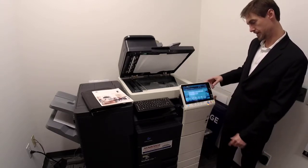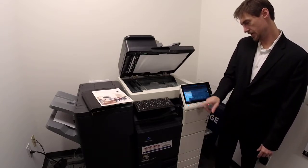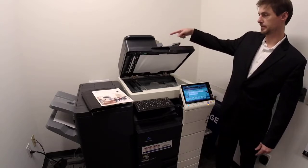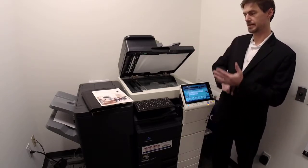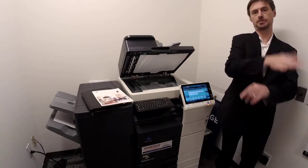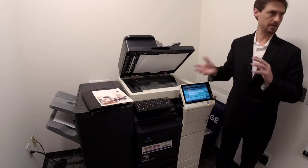If you want to get a little fancier, there's stuff at the bottom. The first button tells it two-sided — meaning it's going to read both sides of the document you put in the doc feed. Depending on your model, everybody now has dual scan single pass, so yes, it is scanning both sides at the same time. Just because it's not pulling it back in does not mean it's not copying the other side.